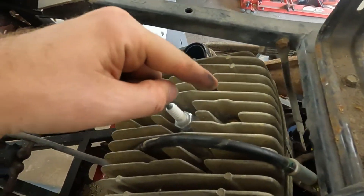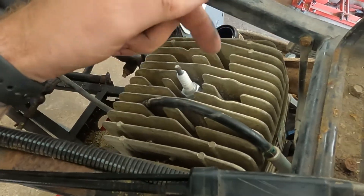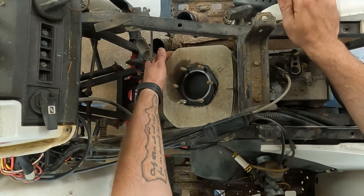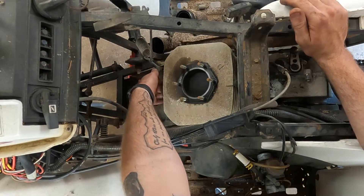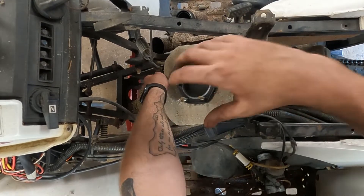I'm going to start with these six bolts up here and then we're going to get the head off, and then we'll worry about the jug bolts underneath. When getting the head wiggled out of here, this stem here does hit — I don't know if this thing just needs motor mounts really bad or what, but this motor moves quite a bit. I kind of used that to my advantage, stuck my fingers in the exhaust port, picked up on it, and got the head wiggled off the studs.